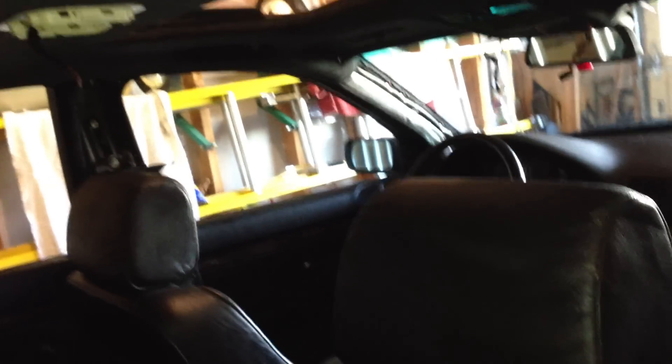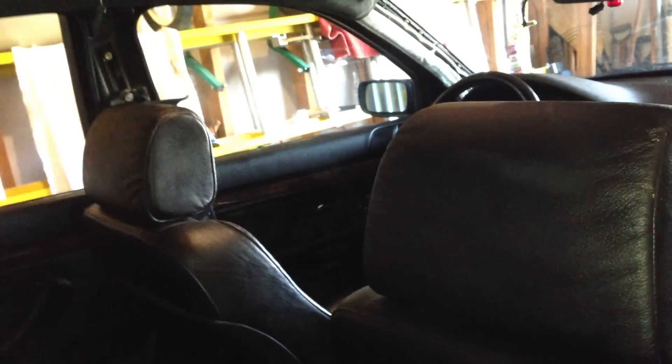When installing your headliner, it's going to take about 20 minutes and is a huge pain. I had to move the headliner in through the door, go up on the center console, spread eagle, reach around like a monkey, and tuck in all the seams. It is a test of endurance to keep your arms in the air holding this headliner up. Once you get it in, slide it the whole way back — about an inch overhanging on the window — then slide it forward while pushing up on the back. That clips the back in. Then screw in all the screws you removed, and that will take a lot of the play out of the headliner.